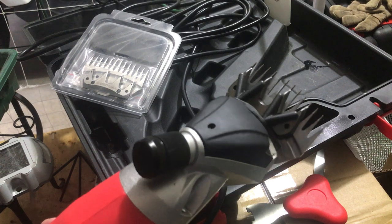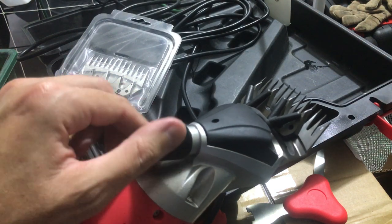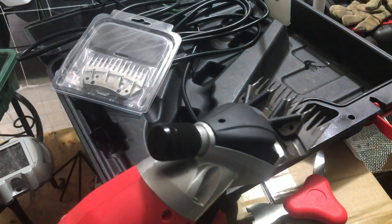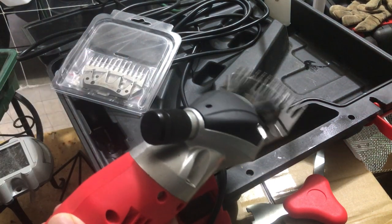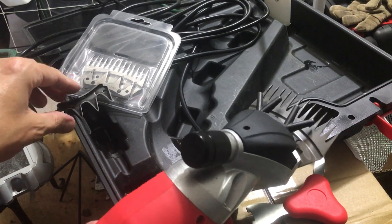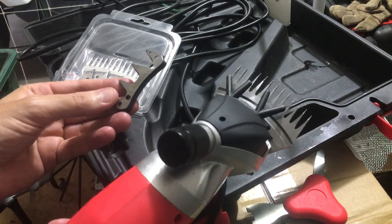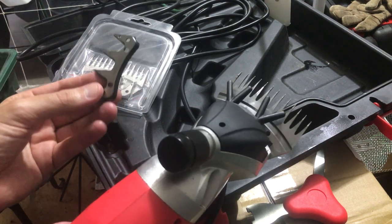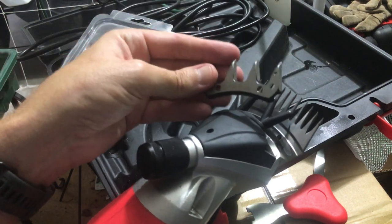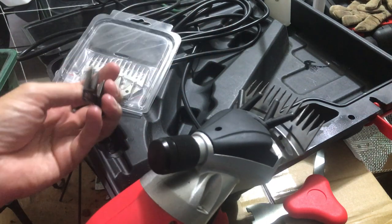So you can get a gist of how it works. If you have the tension knob too loose — I'll try and do it here, I don't know where this is going to fly off to — but if you turn it on, see what happened there: the small cutting blade went flying off. That's what a lot of the comments I was reading were saying — hey, the blades came apart. Well, the blades came apart because your arm is too loose and it can't hold the cutting blade against the long blade.